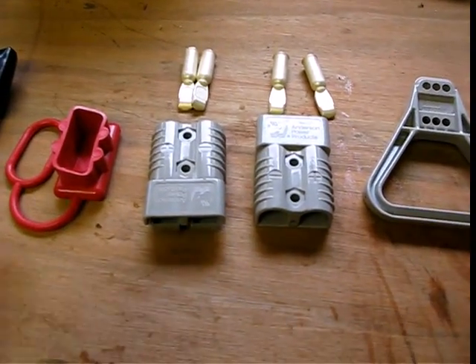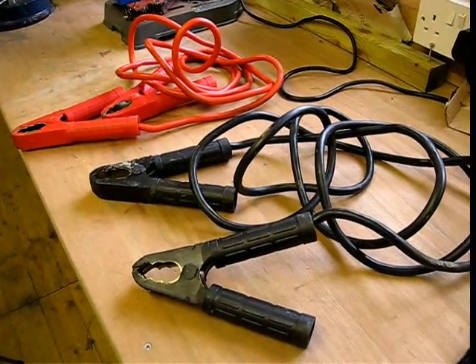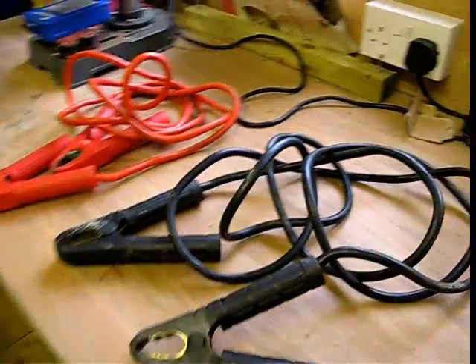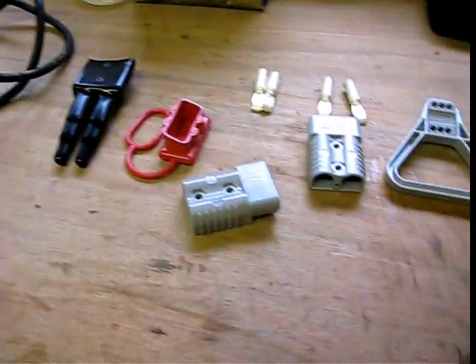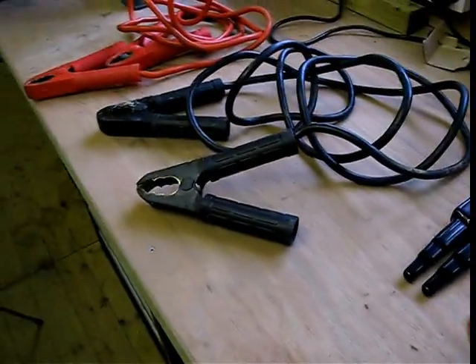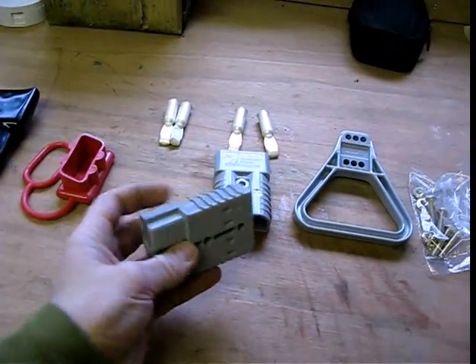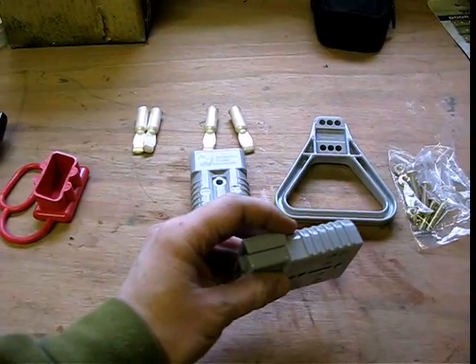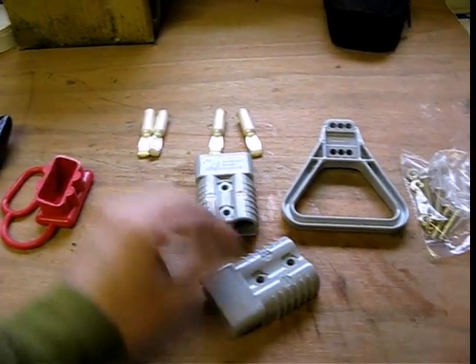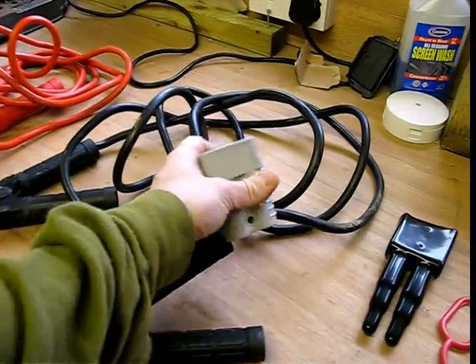Because of the cold weather, I've been having to use my jump leads a hell of a lot. On a Defender, the battery lives under the passenger seat, so you have to keep removing the seat base to get to the battery easily. So what I'm going to be doing, which is a very common thing on Land Rovers, is putting one of these on the side of the seat box and then chopping off the other end of these jump leads and attaching one of these cables.